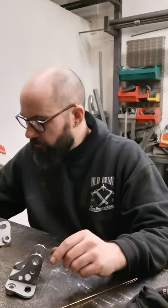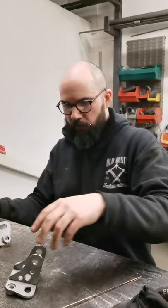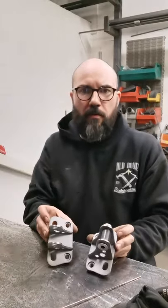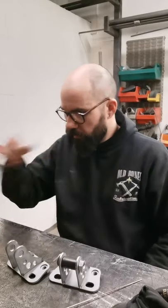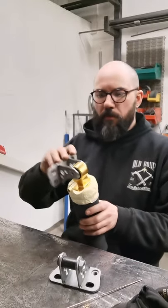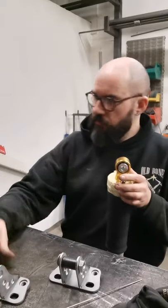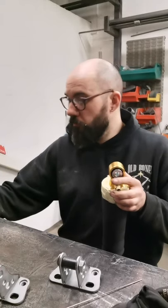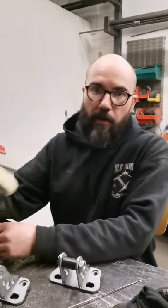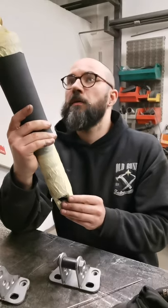That's us pretty much done for the day now. We've made really good headway on the front suspension, actually. What a day. At the minute, I've just finished tacking together these little doobry watsits, so that will be the top mount for our air struts. Nathan's been working on the bottom mounts. They're pretty straightforward. We can use the original A-arm, and we're just making a mount to bolt through the spherical bearing on the lower part.